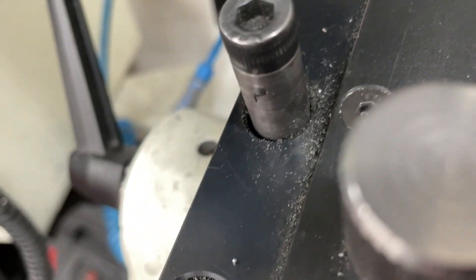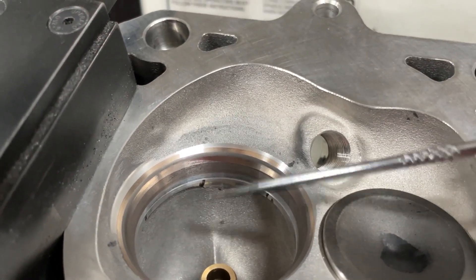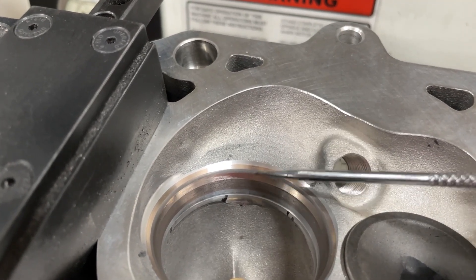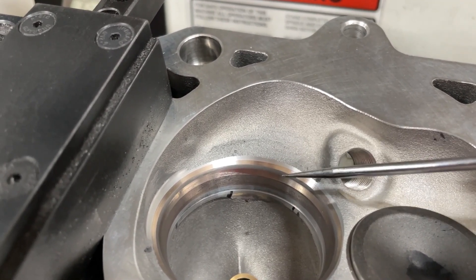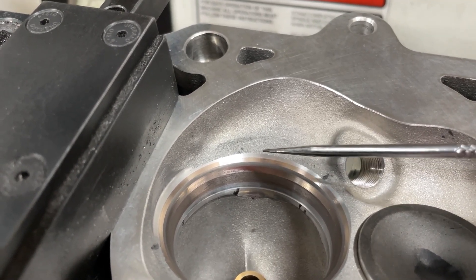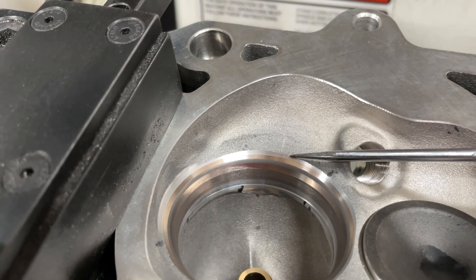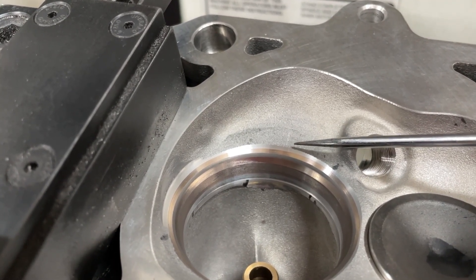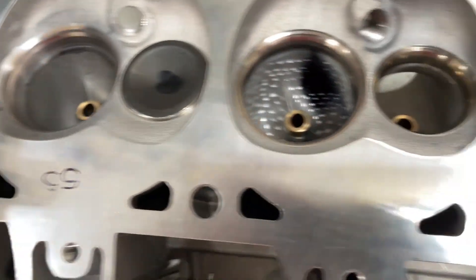The 55 is arguably the most aggressive one. I would never probably put a 55-degree valve job on this, but you asked for it so I'm going to give it to you. The 55-degree seat is right where the lap line is, but the top cut is 44 degrees - that's almost what the seat angle is on the others, which means it's really stood up. I have to sink this valve job down quite a bit just to get any of the top cut to come into the chamber. This one's probably sitting down 15 thousandths steeper than even the 50 because of the top cut angle, but I wanted to give it a fair chance to do decent.